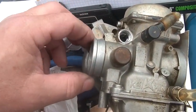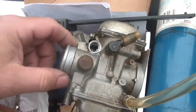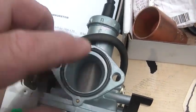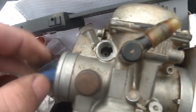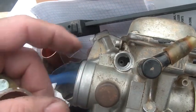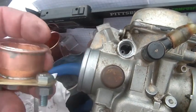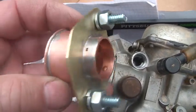I needed an adapter. This right here is 38 millimeters — you can use your Harbor Freight gauge to confirm that. It has a square flange, so it won't work directly. I made an adapter. Notice how this thing has a ridge: as you push it on it kind of snaps in, and then the clamp settles down and seals around the outside surface.